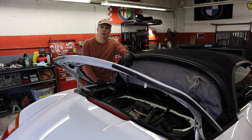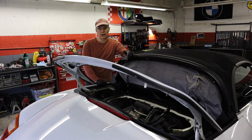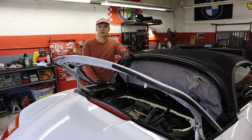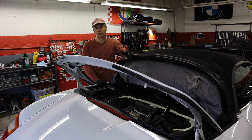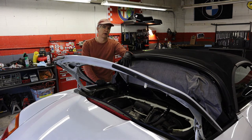It's been remarkably reliable, but recently one thing I encountered is that sometimes when I would start it, it would not catch and idle. I thought perhaps the battery was getting low voltage, so I put a new battery in it, but that didn't help. So the next step was to remove and clean the throttle body and the MAF sensor.